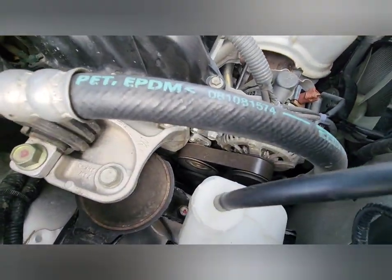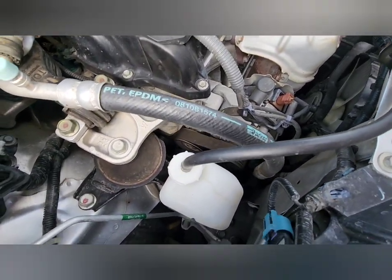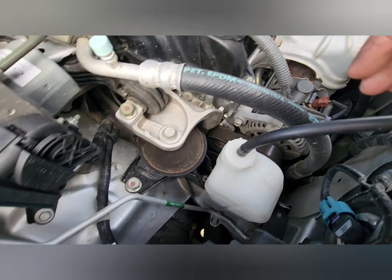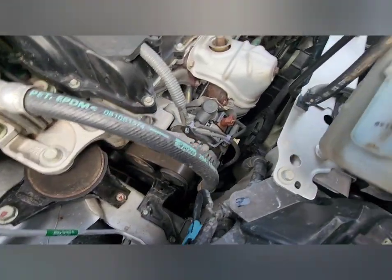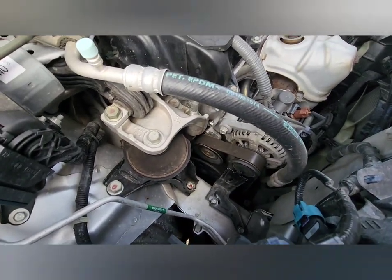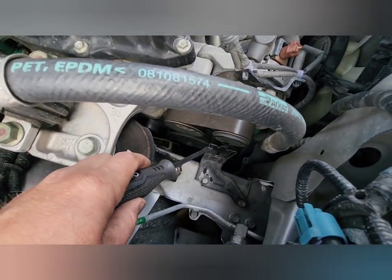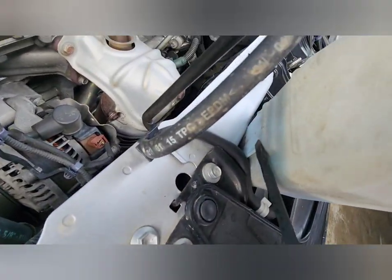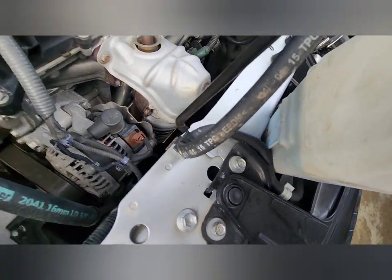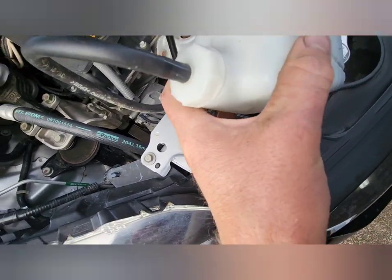Here's your serpentine belt right there. What I like to do — I've already done a little movie magic for you — is remove your coolant reservoir here; it just slides out of that notch down there. You just take your screwdriver and pry this tab right here away from the plastic bottle so that way it slips out if that groove catches on here. Then you can just let it sit right here — it'll be fine, you're not going to have to spill it.